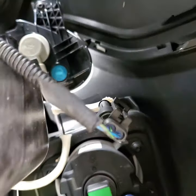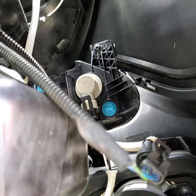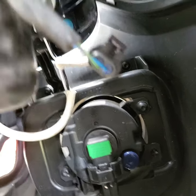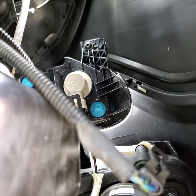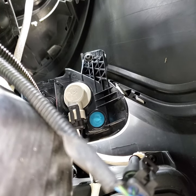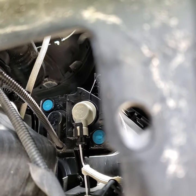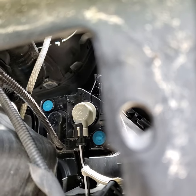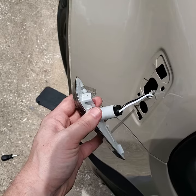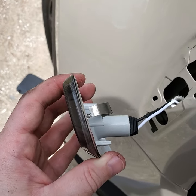This is a view inside of the compartment where the light is. There you can see the white rear of the blinker. Down lower is our fog light — make sure you don't pull that one off. Turn it one way or the other; they're different on both sides and it will release and pull back towards you. If you ever want to change your daytime running light to LED, it's right to the center of the vehicle from the side you're on. With the bulb in the light, it should look like this — all the way seated up to the ridges.